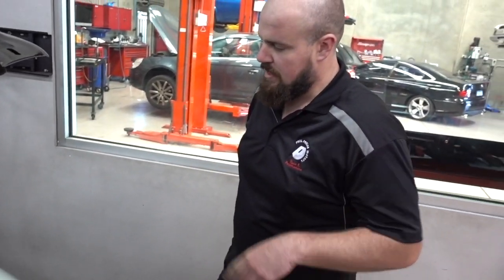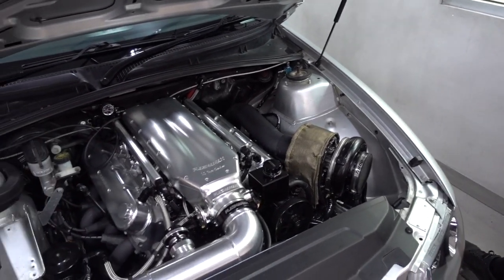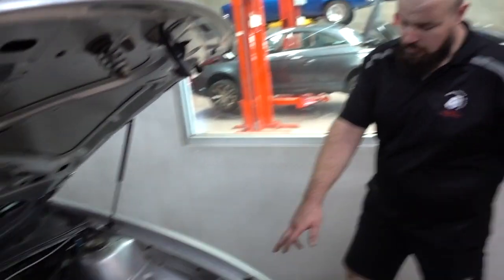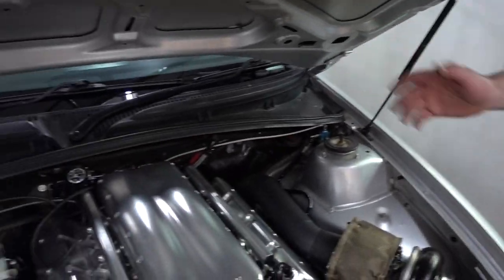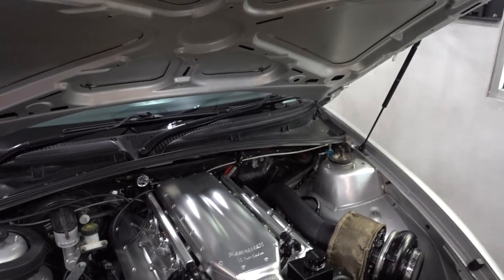So what did we end up doing there, mate? We put the wastegate back on and reverted back to our 14-pound setup — two 7-pound springs to make a base of 14. We weren't seeing the boost we wanted, only about 8 pounds. So as a quick test, I took the pressure line off the front of the compressor housing and moved it to the back of the manifold, just to see if we were getting a pressure drop through the piping. And we actually picked up to about 11 and a half, just almost touching 12 pounds of boost.